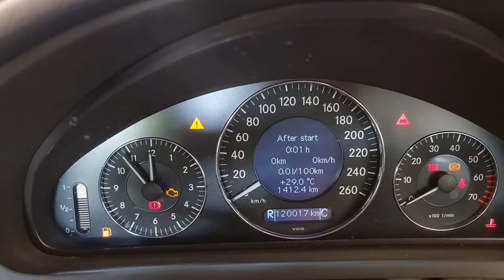Also, I have checked my TCU for fluid damage and if it's fluid affected, and it was not. Also, my generic Bluetooth cheap scanner showed me that there is a P0705 code, and also my more expensive scanner also confirmed that. So I'm pretty sure that my gear shifter is faulty, and I'm going to change that, and I'm going to actually fix the oil leak, and this is going to happen in the second video.